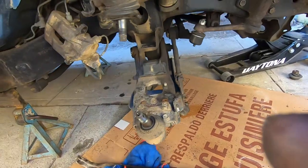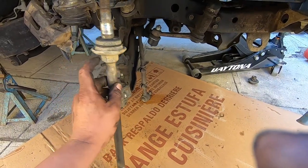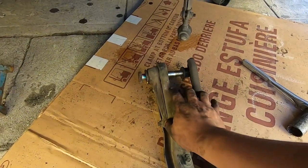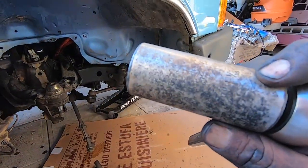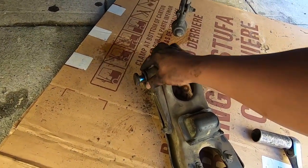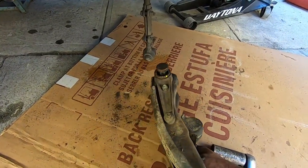That nut might be like a size 30. We got the nut from there and we didn't move the nut in the back — we just did the top. When we go back we're gonna tighten it and it should be back to where it was. We have the lower control arm out — we broke it loose with a 1 and 1/16 socket, then tapped it in. It has splines and slides into this piece, held on by two nuts. We got it all the way through and it came out.